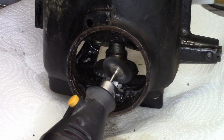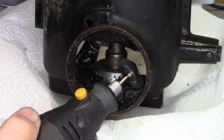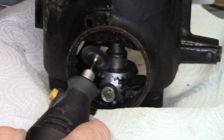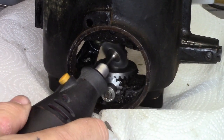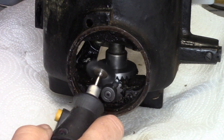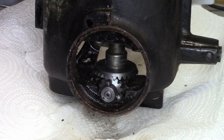Here's something you might not have considered: once you've got the majority of the greasy crap off the surface of the gears, you can clean the rest of the exterior portions of the gears with them still attached to their shafts and still in the machine. I'm using a rotary tool with a small stainless steel wire brush to get the majority of the big crap off. I'll go back in later with small stainless steel cup brushes and clean a lot more off. The quick-drying contact cleaner that we use for electrical components works wonders to help pick up that crap.